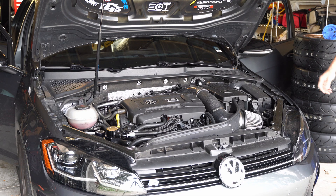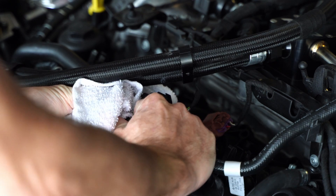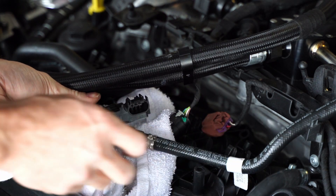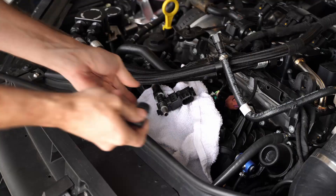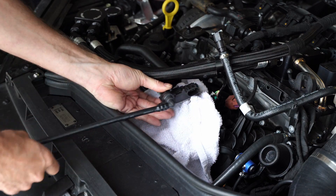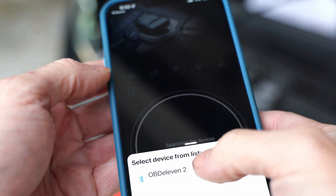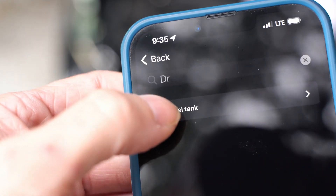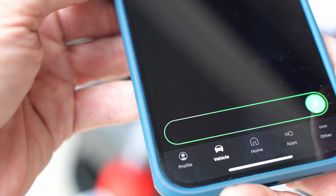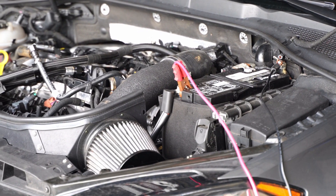In order for this process to go smoothly, you really want to make sure you have the fuel tank level as low as possible — drive around until your light comes on and you know you're very low on gas. I totally forgot I was getting ready to do this install and filled up the tank a couple of days before, so I'm going through the process of draining the tank. I've done a separate video on this, but essentially I'm using basic settings in the engine module and then draining the fuel tank into a VP Racing can. The way I'm getting access to it is where I already had the fuel line quick connections put in for my ethanol sensor. But if you're planning ahead, you can just drive the car until you're low on fuel and then do the install.